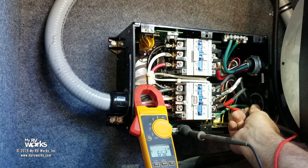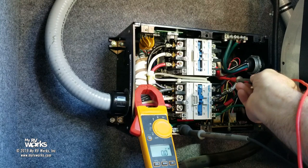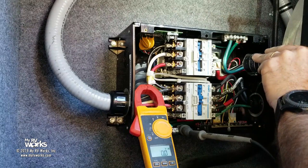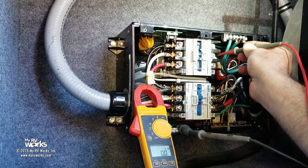I'm curious about this board right here. Now watch this. Let me get to the same spot. You got it. Oh, there we go. Sealed in. There is A2. Now look, A2 only has 65 volts. And let me get a flashlight. I need this cord rail moved out of the way. If I can get my eyeball on where A1 is, way up in there. I see it. Okay, I'm on AC, and I'm going to probe right in there. See, I've got 65 volts on that.